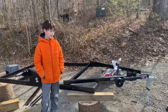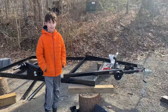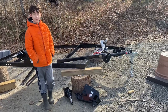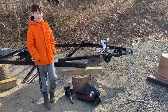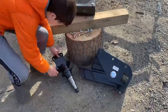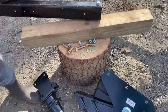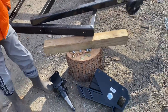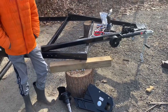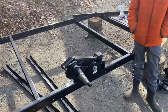To get started, we've flipped our trailer over, which allows us to put the suspension system on top so it's easier to work with when mounting it. The system came needing some assembly — the spindle needs to be bolted to the other part using the included bolts. It does require a torque wrench, so you'll need one of those. It's not the easiest thing to put together; I've assembled this one and placed it here as a placeholder for now.